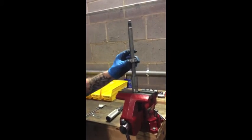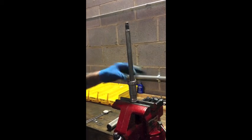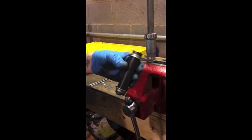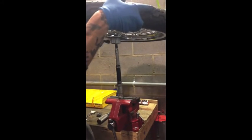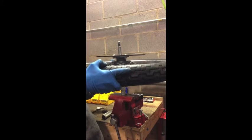We're going to take one tapered bearing, put it down on the axle with some spacers underneath it. You're going to have a sleeve here — some of them will have this, some won't. These little discs just keep the inner sleeve from falling around inside the wheel while you're trying to set it up. We'll slide that over and down on there with the taper bearing pointing up. Then we're going to take our wheel and install it very carefully — you do not drop it on there. If you drop one of those bearings, you're going to need to replace it.